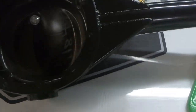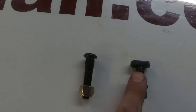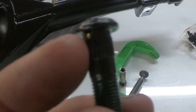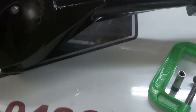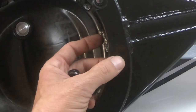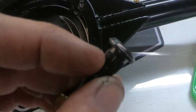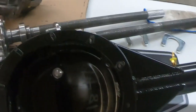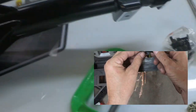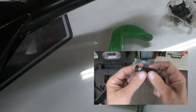I'm going to start with a little prep work on the 9-inch. The kit comes with two sets of bolts — the original T-style bolt that Ford used, and then this one which we're going to use. It has a knurl on the outer edge. The directions say if the bolt doesn't want to go through, do not drill it out. Instead, get on the grinder and take a tiny bit off. I've already done a couple and have four or five put in already.